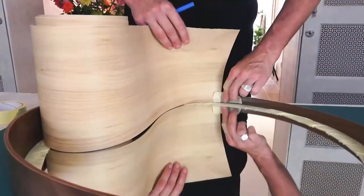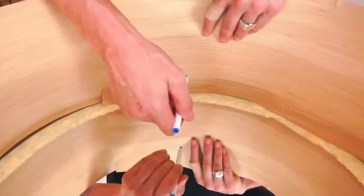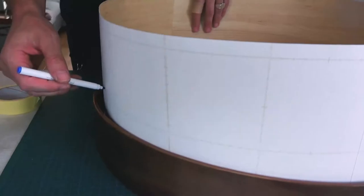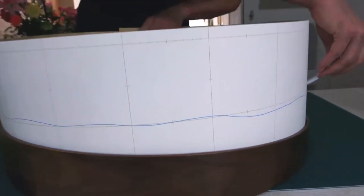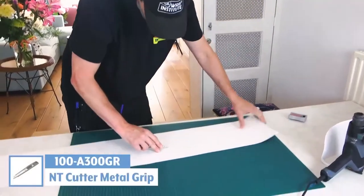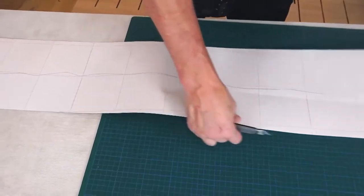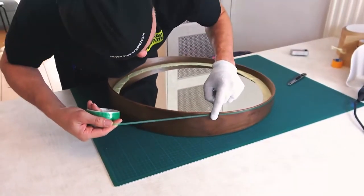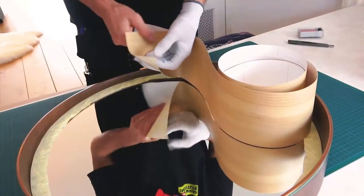The next step is to prep the panel. Using masking tape to hold it on one side, unfurl the panel, then mark where the overlap will be with a dry erase marker. Estimate where the material needs to be cut off so there's just enough material to wrap around but not too much. On a cutting mat from CoverStyle, trim the excess film away. Then place 3M knifeless tape — in this case precision line — on the top edge. This will help cut the film without having to use a knife.